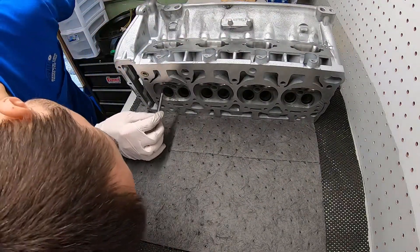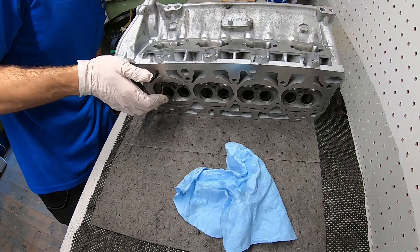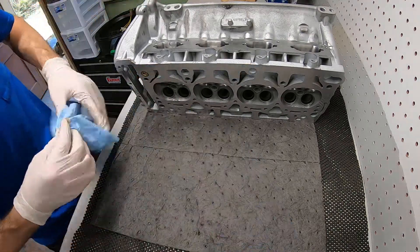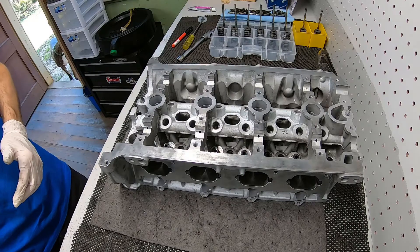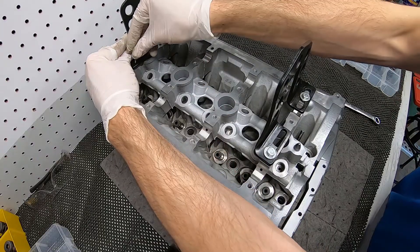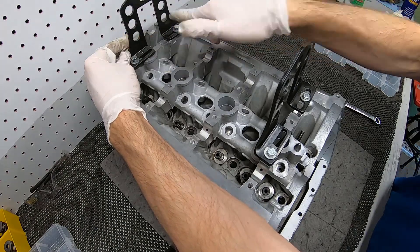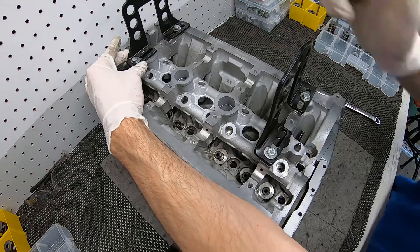I'm going to install the number one valve back in the spot where it goes — right here. I'm going to massage it through the seal. This is a valve spring compression tool kit. You'll see how it's designed here in a minute. Basically you have these two horseshoe-style braces that you have to bolt down in various locations back on the cylinder head. I happen to already have the right metric bolts set aside.